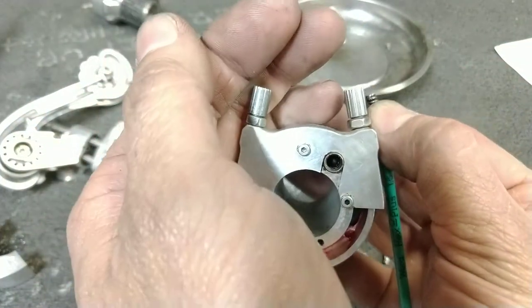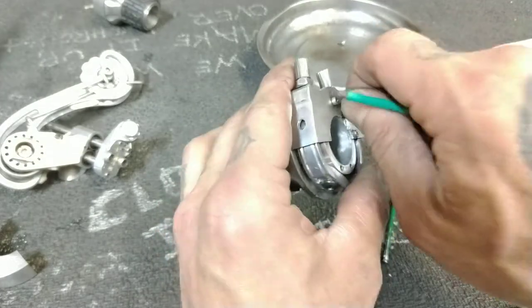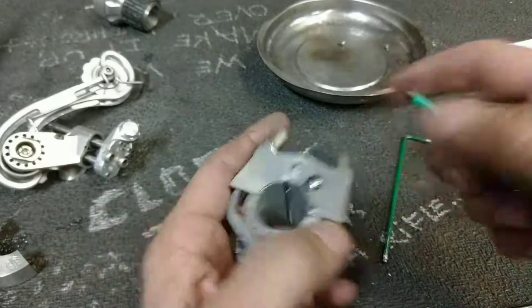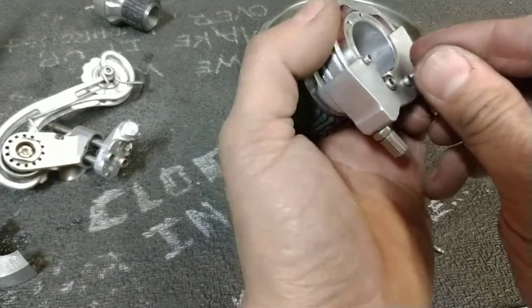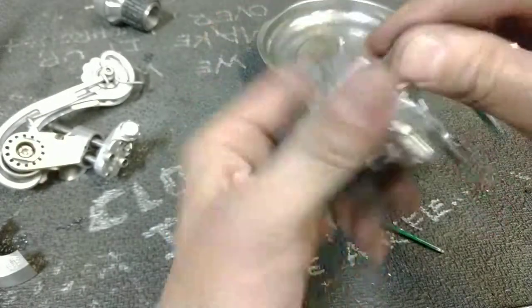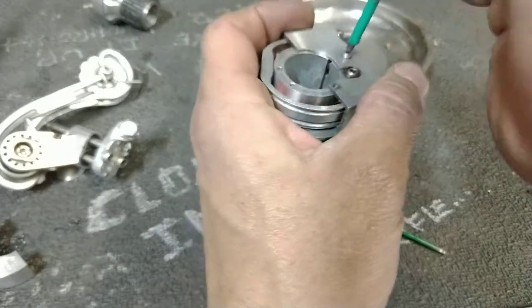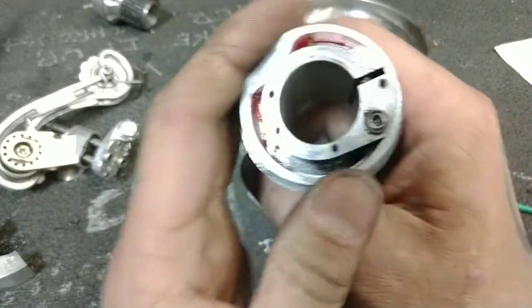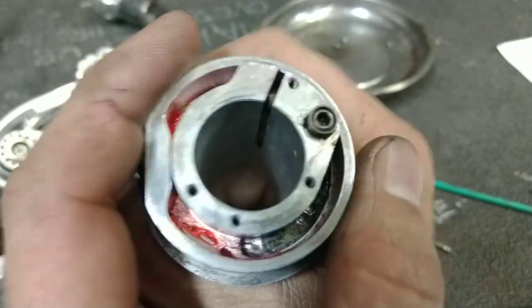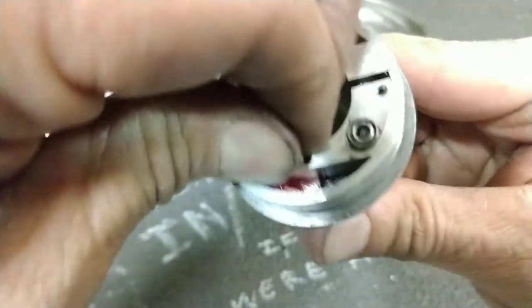So at the bottom of that hole, there's a ball bearing. Spring is on top, and this set screw applies pressure to it. And there are corresponding divots in the bottom of this shifter. Remove two more of these ludicrous 1.5 millimeter screws. And you can see we have our small recesses for the ball bearing. And it goes click into each one of them.